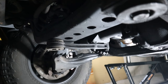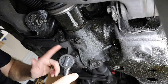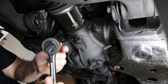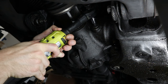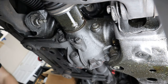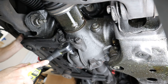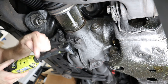For the front diff, the fill plug is up here and the drain plug uses a 10mm hex key — not a socket. I put the hex bit on the end of my ratchet; these are very convenient, a cheap Harbor Freight pickup. Couldn't find my breaker bar so the electric ratchet — a Ryobi — will hopefully get you the torque to break it loose. That thing was really on there. Same procedure: loosen the fill plug first, then set up your drain pan below before tackling the drain plug.